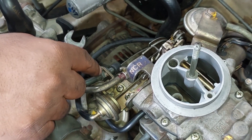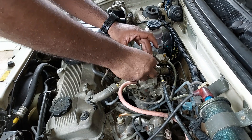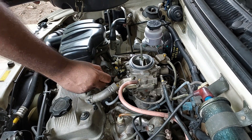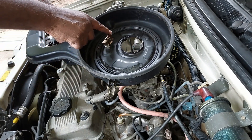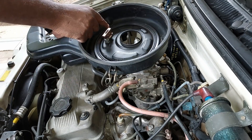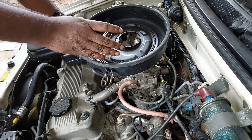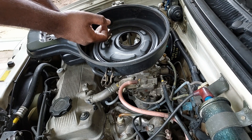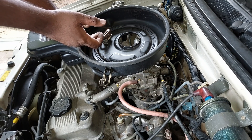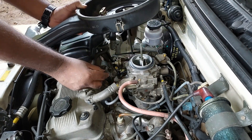Now let's connect the air filter. Let's understand the purpose of the hose under the air filter. This hose connects a valve inside the air filter to the inlet manifold. This valve is called a hot idle compensator. Inside this valve, there is a bimetallic strip. When the bimetallic strip heats up, it bends. As the engine heats up above 45 degrees Celsius, the bimetallic strip starts to bend, which opens this valve. The valve is completely open when the engine reaches hot condition, around 65 degrees Celsius. At that time, air from the air cleaner directly enters the manifold via this hose.